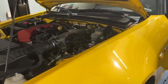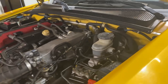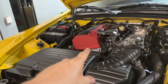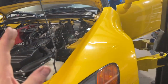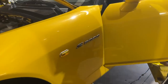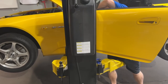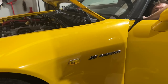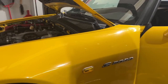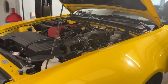The clutch is done, master, slave, and line. The clutch is bled. The engine components are going to be next, and then we'll do the engine oil too. Trans is done, diff is done. We'll go ahead and start it, make sure the clutch works, and see how that flywheel reacts. The starter sounds so nice when they're new — they just light right up, you can hear how quick it starts.